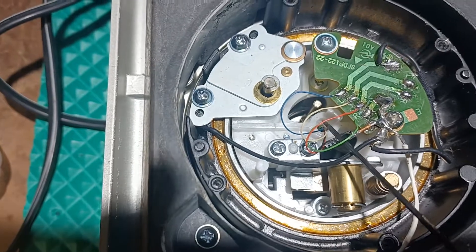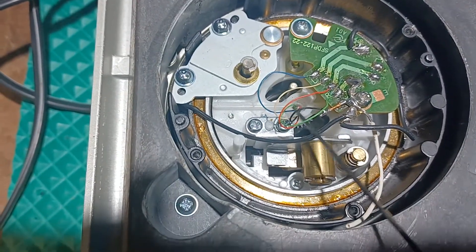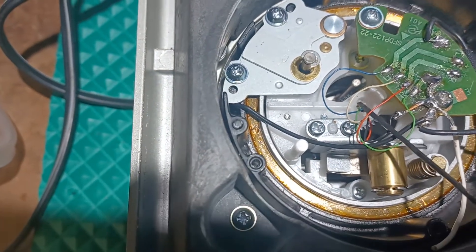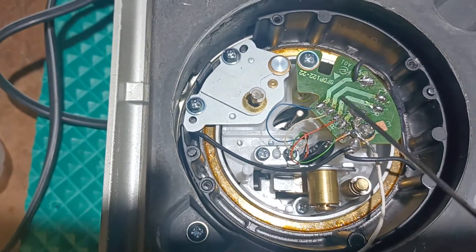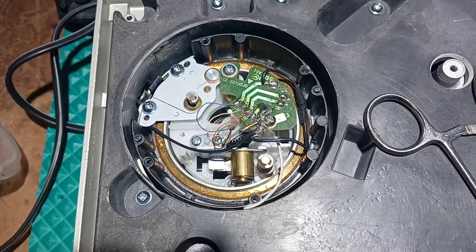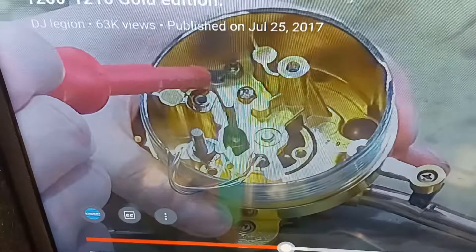So it's very important if you do work on a tone arm and take it apart — that little kind of triangle-with-its-nose-cut-off shaped hole is where these little wires go up before they go through the center of this white plastic piece. The white plastic piece is just on top of all of that contraption. So they go through the side hole there, then you snake them up through the center of the white plastic piece and then back up onto your board. It involves taking all this apart, but problem solved — I just wanted to point that out because it seems like an easy mistake that somebody would make.